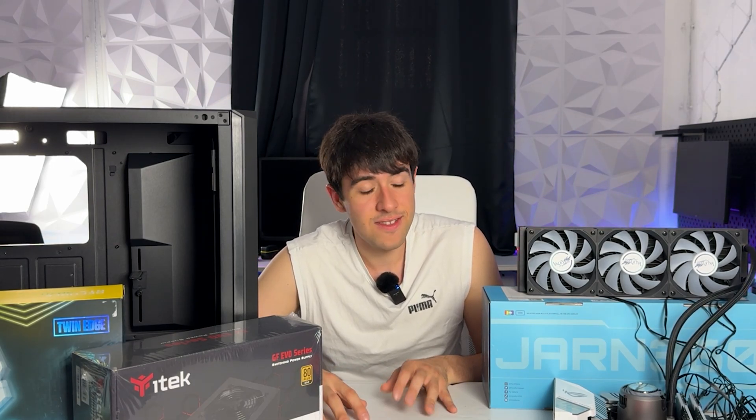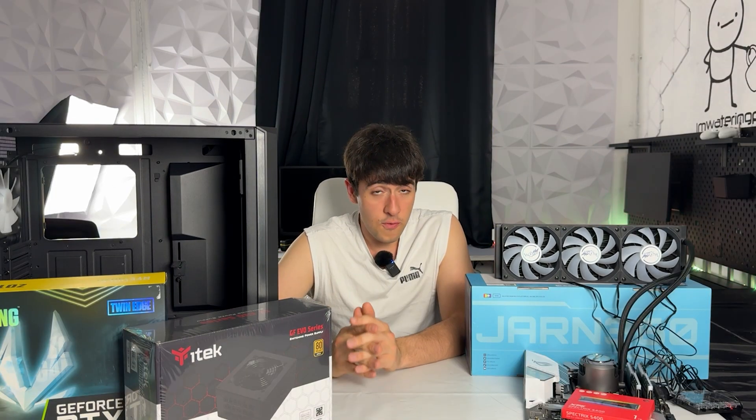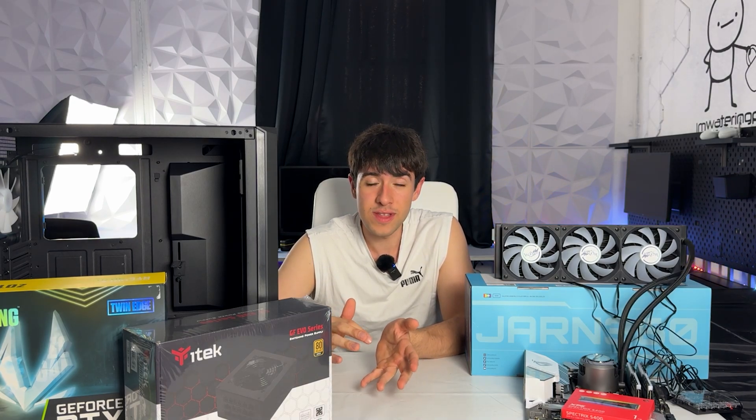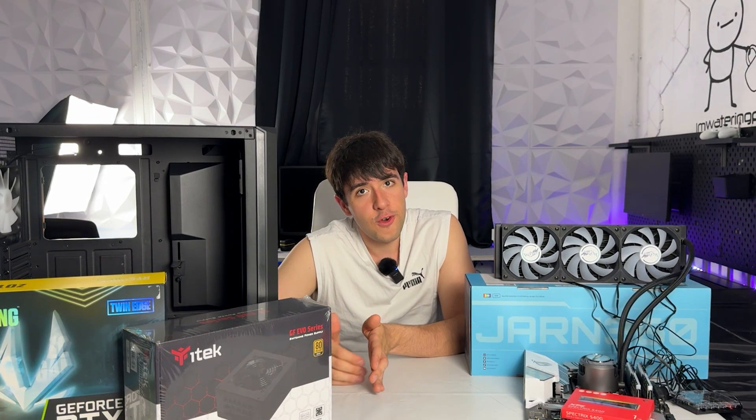Getting broken stuff is fun. We also try to fix broken GPUs on the channel using unorthodox methods, sometimes washing it, and that's also what we've done to this motherboard. To fix it up, we cleaned up the socket, used some quality water - unfortunately I did not record it, but there are plenty of videos on the channel where I do it with a garden hose - then bent the pins back one by one and flashed a new BIOS with a manual programmer, and now the board is working fine.